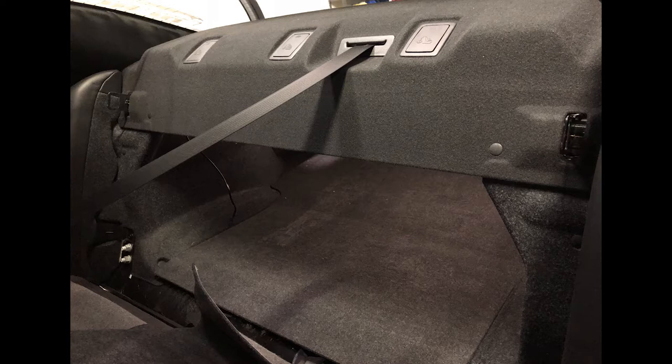At this point, it would be useful to have a partner to give you a second set of eyes to help you balance it, but it's not absolutely imperative, so you can do it on your own. We're going to need a center point to affix the glass to the panel. This clip right here in the center is on the center of the rear panel, so you can use that to line up with the center screw on the metal bracket on the bottom of the product. As long as you've got it matched up with that, you should be golden.